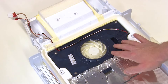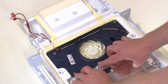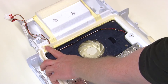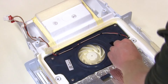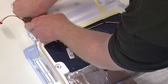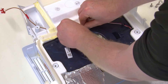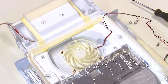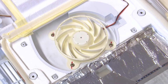To get the fan cover off you need to roll back the foil at the bottom and also the adhesive tape at the top that is holding the wires in. Now to remove the fan cover, remove the four screws and unclip the wiring. To remove the fan, undo the three screws that hold it in place and pull it away.